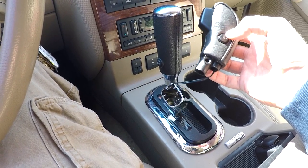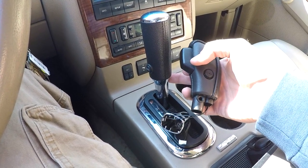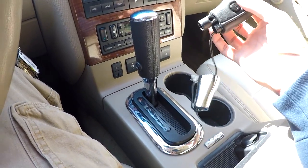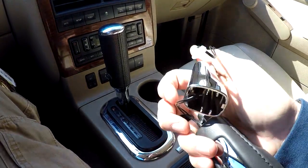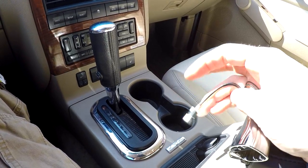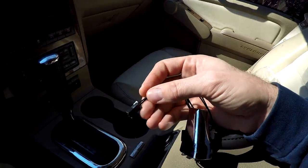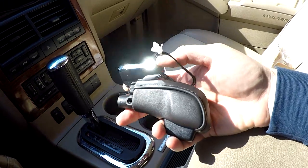The only things we have to do as far as modification — it's not too bad from what I understand. The stock one has one set screw holding it in place. This one has two set screws, and you just have to drill and tap two holes. I believe these holes are lower, so you can't just reuse the existing hole. The other problem is the stock overdrive button plug wire — it's not the same plug. Everybody else I've seen do this has actually cut and spliced wires. I'm going to try not to do it that way, but we'll see.